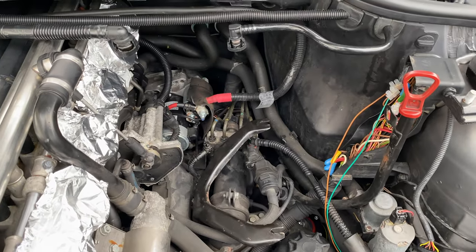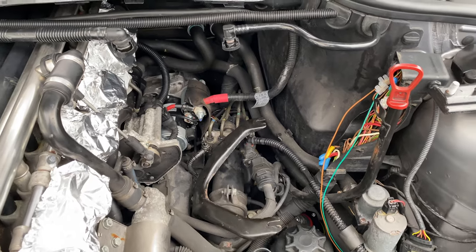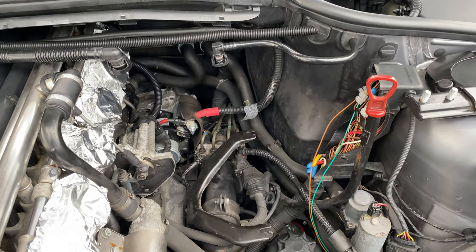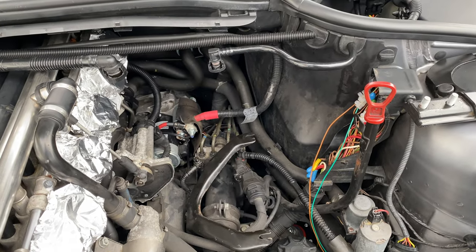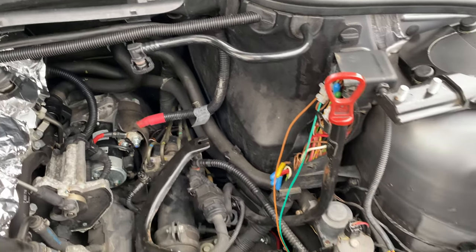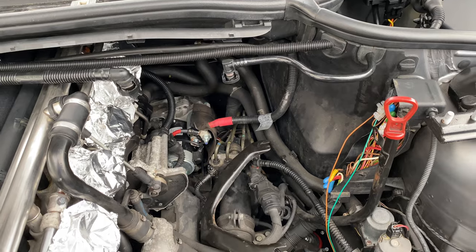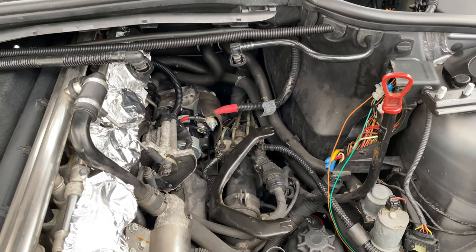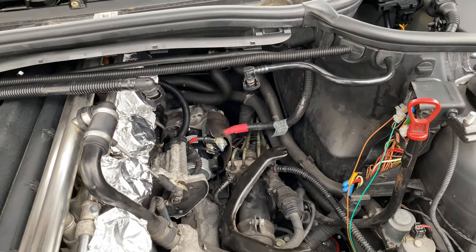So having a quick look online, it looks like I'm going to have to use a company called ECU Works. I've heard of them from the past with stuff with the E92, and hopefully I'll be able to change the scaling back to the CSL spec sensor. So we're going to carry on with the wiring repair anyway, and obviously remove that MAF plug, get the airbox on, because it'll all be done on the computer at a later date. But you can't drive the car, because like I say, it's reading about 20 degrees off, which will make the fueling well wrong.